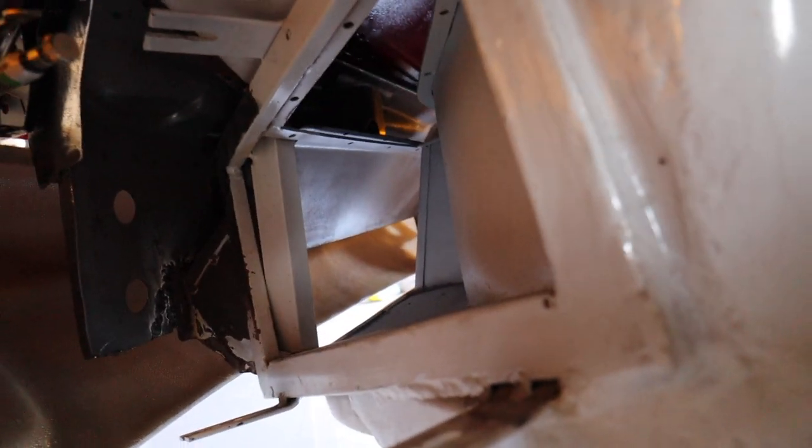What I've done is, in this particular car, the entire tunnel area has been really cored out by the previous race car owner. So I think that I can fit two hard lines, two aluminum 1 1/4 inch pipes right into the middle of the tunnel to use for coolant lines. So I'll be able to connect the engine to those lines, run them up front to the areas where the front radiators will be, and then back, and it'll be super clean and super efficient.